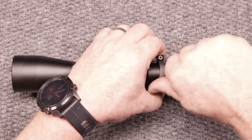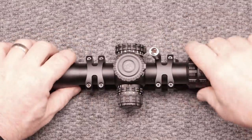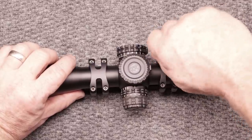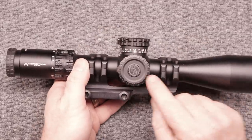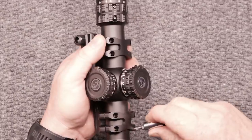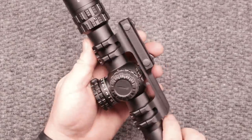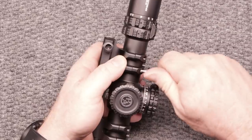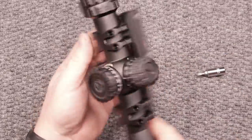One of the other things we also like to do — eventually when we do get it tightened down, I want to ensure that my gaps here and here are equal to those over here and here. As you notice, those are tight. All you have to do is just loosen that up half a turn, tighten half a turn, tighten half a turn. Eventually what'll happen is they'll equal out. You can also use a gap gauge like you do for spark plugs, if you're that critical about the spacing in there. I just like to make sure that everything is perfect all the way around.